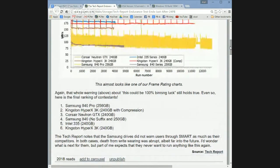Well, Samsung's number on that, I believe, was simply 2x the endurance, right? So there you go, that same capacity. They only tested, and this is important too, a 256 gig 840 Pro. It's not a 1 terabyte 840 Pro that would have only cycled the flash cells 1/4 as much as this one, right? Yeah, he'd still be many, many years away from finishing.